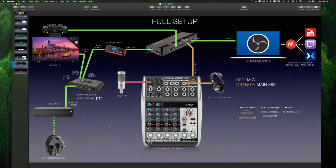Here's my full hardware detail. I'm using an Xbox with Plantronics headphones, going into the GoFanco splitter. The dip switches on the splitter are all set to the up position — all four switches up — which gives me the highest quality 4K out to my television and automatically sends 1080p 60 frames per second into the capture card. From there it plugs into a USB hub, along with my Logitech webcam. I'm using a mixing board for audio with a headset and a Heil PR40 microphone, all going into the USB hub on the Mac, running OBS, and using Restream.io to stream simultaneously to YouTube, Twitch, and Mixer.